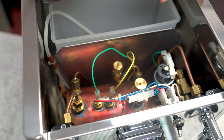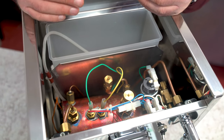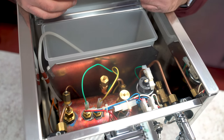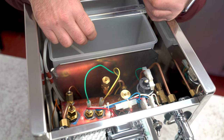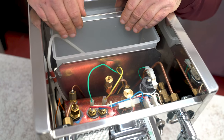These are the two areas where Bezzera has built safety into their system to protect the heating element, pump, boiler, and components. The machine thinks it's out of water, but if you're using water that's too pure — distilled or reverse osmosis — it's going to think there's no water. Some customers have confusion with that, and one fix is a pinch of salt in the water so the five volts can pass through the reservoir.